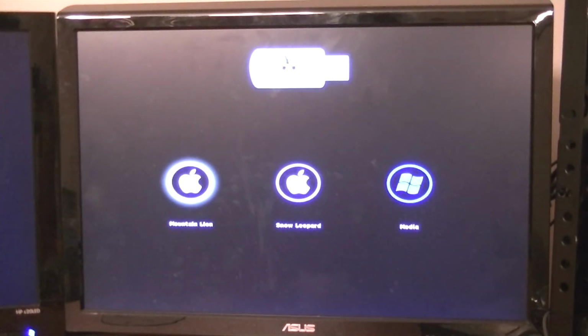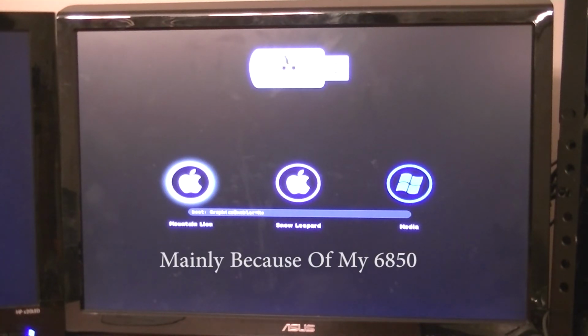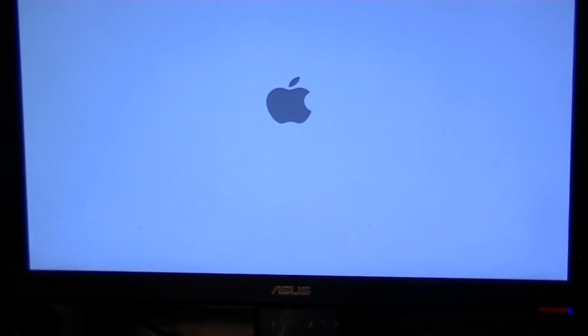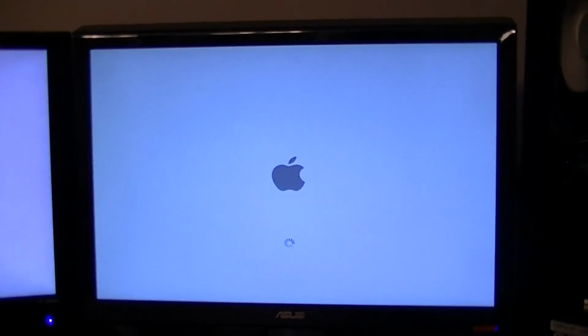Now, I removed the 6000 controller, and for most I would recommend doing graphics enabler equals no, and just to be safe, we can go into safe mode maybe. And see what that gives us. Alright, finally. I was kind of getting worried there. Hopefully we get it. Yes, we did. Perfect. Everything is going as planned.